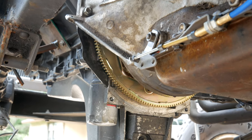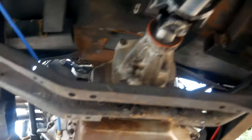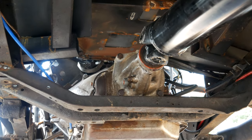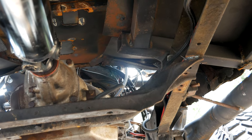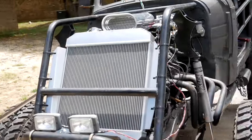Under the car you can see the shifter all wired in — cable linkage going straight to the Turbo 350. It's a B&M shifter that came as a complete kit, super easy to install, took about 10 minutes. I reused my stock CJ5 cross member from the 79 CJ5 frame — welded it directly to the frame rails and to the mounting bracket on the bottom of the Turbo 350. I also have vacuum going to the manifold. The only two things not hooked up are the cooler ports, waiting on fittings for the trans cooler, and the detent cable, which I'm skipping since the car should be light enough without kickdown.